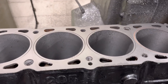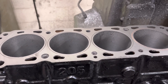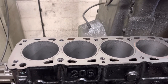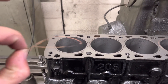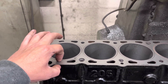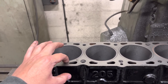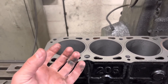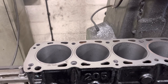If you see in the top of this block, it's got the wire rings — the copper wire rings that you used to put on. When you used to use the fibre gaskets back in the day, they would put these copper rings in here. They're about a millimetre thick. What they used to do is put them about 25 thou deep into the block, and then they would protrude about 15 thou. The idea of that was to bite into the fibre gasket fire ring so it holds the compression.